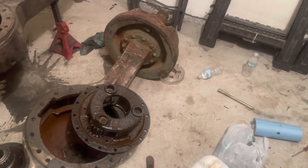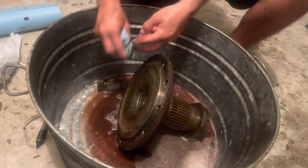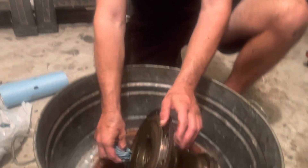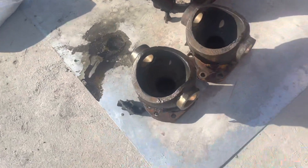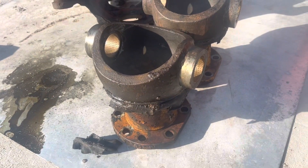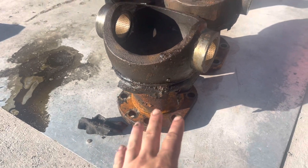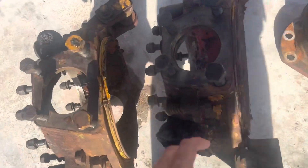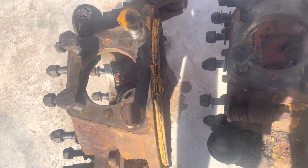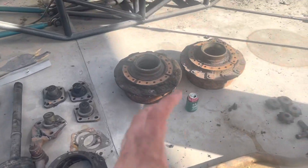One of them just wasn't sealed up properly, so now we have the spindle in our cleaning station and it is in rough shape. These are the kingpin flanges, and we're going to get flanges made to bolt onto a five-ton housing. There's where our steering is — the kingpins are just massive. These are our big hubs, which are home to the planetary gears.